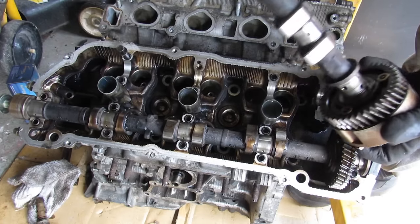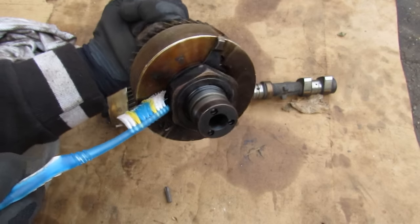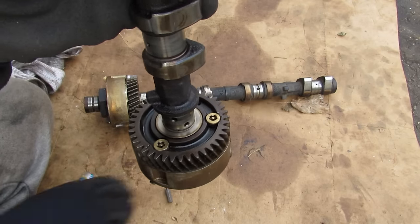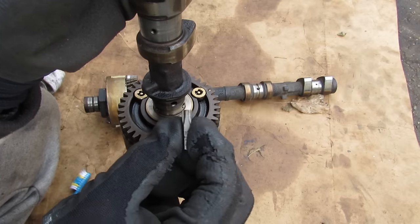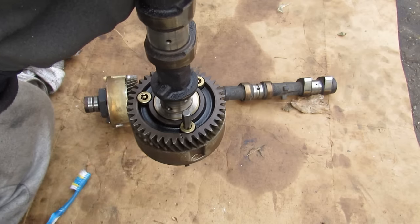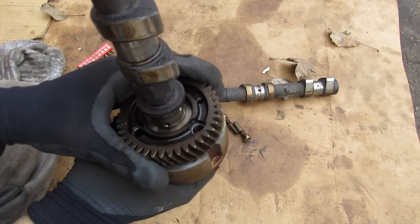Let's pull this out and take a look at what's going on inside this variable valve timing actuator. Taking a closer look, it's got this big nut on the back. On the front side we have these fasteners — they're not Torx but instead a security bit with a dot in the middle called a TS-40. You just put this in here to undo these screws. I got a pack of these on Amazon for about 12 bucks — link in the description below. With those bolts free you can pop off this gear.